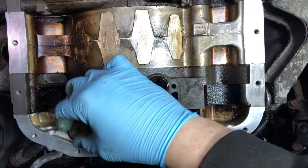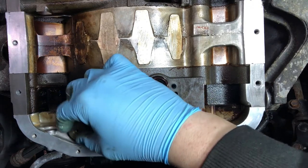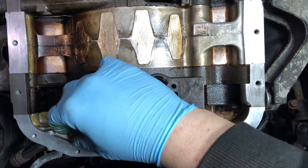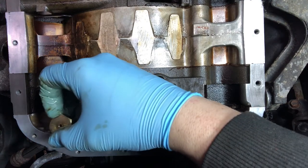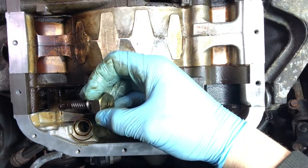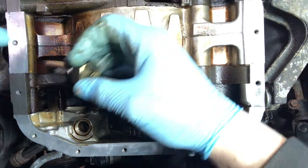There will probably be some oil come out of this. We have drained the engine extensively because we've obviously also dropped the oil pickup. But as you can see, as we take the cap off, the relief valve is still retained within the front cover, but you can see the spring and the cap.